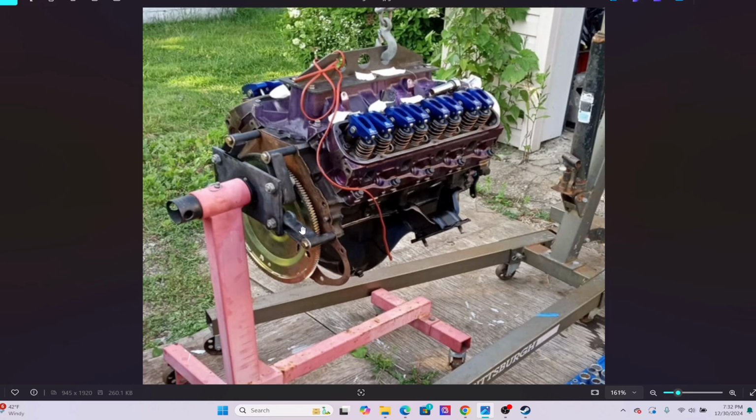Now, the thing about this being thicker, though, when the torque converter is pulled forward to be able to put your nuts on it, is that they were just about flush with the stud. Any less, I wouldn't have felt comfortable. But those were ARP, use Loctite, so I think it's pretty much good to go. And then it was all torqued to the proper specifications. So, yeah, just make sure you check that play, that you can move your torque converter in and out.